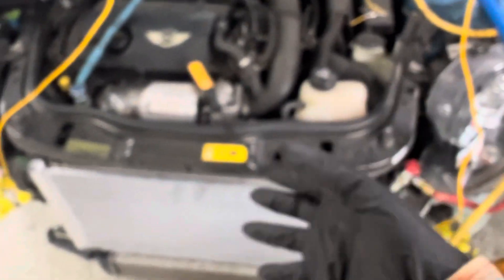And that is the 2012 Mini Cooper — brand new condenser. It was in an accident, got hit a little bit. It didn't puncture it, so I did the recovery last week. This was just thrown on about 20 to 30 minutes ago. So that's it — simple, in and out, really fast. Discharge and recharge really fast. Swap the condenser really fast. That was about as easy as they get.